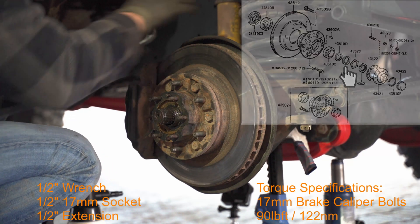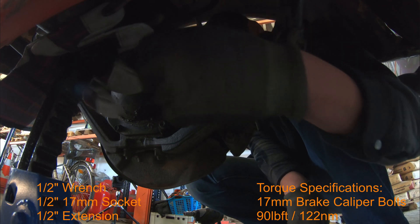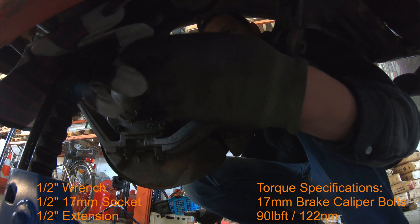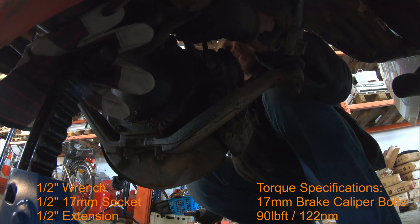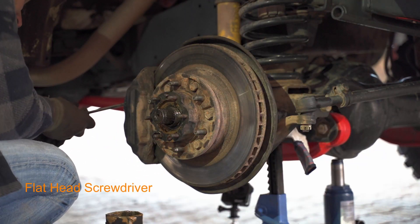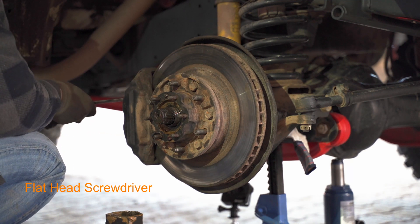One difference you might not see in many videos: I left the brake caliper on until this point because it fixes the assembly slightly and makes it a little easier to work. It's just a change of process — maybe try it out. The lower caliper bolt you can reach with an extension and a 17 millimeter socket; the upper one you cannot use an extension, so you just use the ratchet and 17 millimeter. Then pry a little bit on the brakes to loosen the caliper and push the pads inside so you can remove it easily — a regular screwdriver works fine.